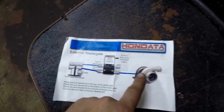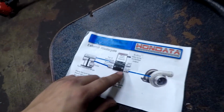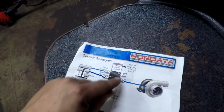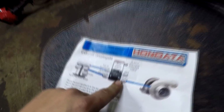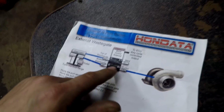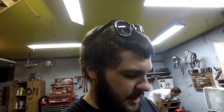And pretty much you want the nipple off the turbo, so this car has a 1/8-inch pipe thread nipple off of the turbo, which I just ran a vacuum line off of, and that vacuum line off the turbo goes into the intake of the boost control solenoid. The solenoid is labeled, it has intake, exhaust, A and B. So the intake is going to come off the turbo, go into the intake on the solenoid. The exhaust, it comes with a little vent. It's like a little screen thing that you just plug into the solenoid.